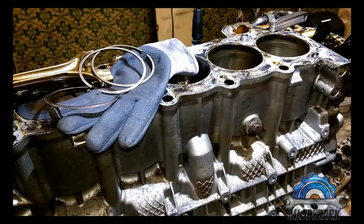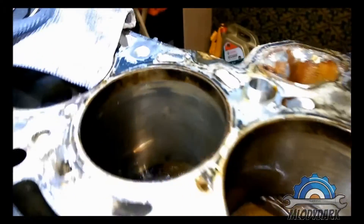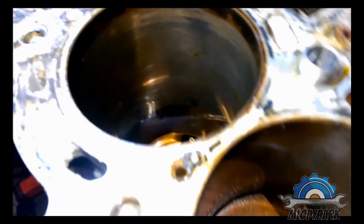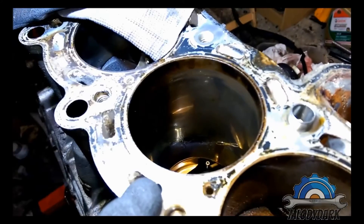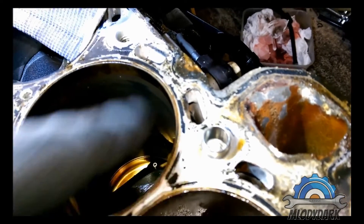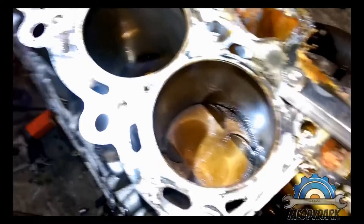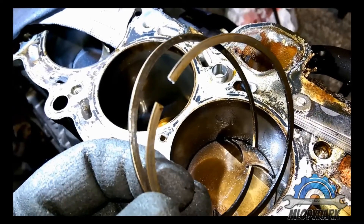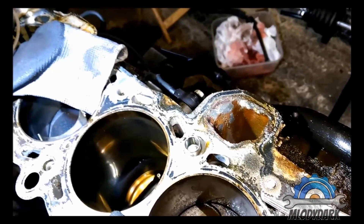That's a proof for me that M54 engines are just terrible. If they could make a block with the same spec as you can see here - aluminum block with cast iron liners - they can do the same block with almost the same pistons, same crankshaft, just different rings. Why are the M54 ones worn when the engine actually has the same mileage?